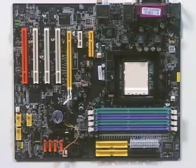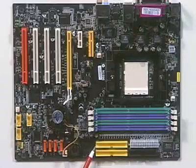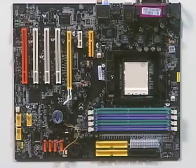We also have a connector down here that we use to connect our floppy disk drive to the motherboard. And we also have two connectors here that we use to connect IDE devices to our motherboard. Now, in addition to IDE support, this particular motherboard has serial ATA interfaces built in as well. We have 4 of them right here.